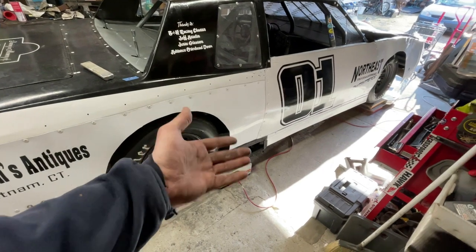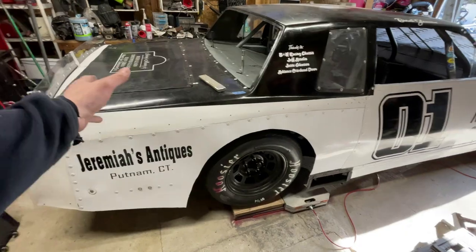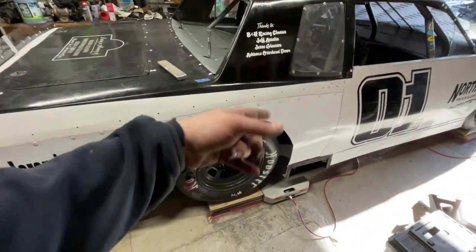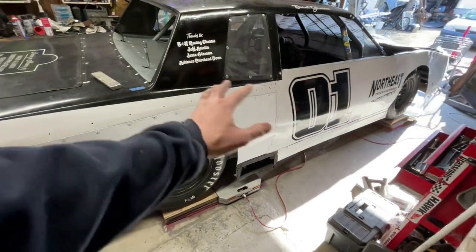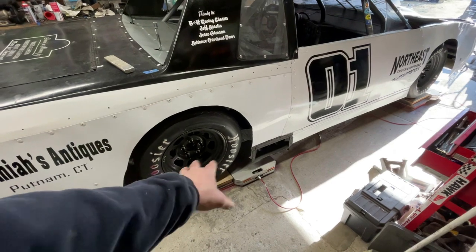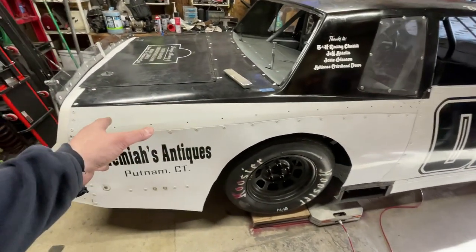So if you're going to race, you've got to spend money — might as well spend it on stuff that works. We made a ton of changes to this car: I had to change the whole rear clip, the spring buckets — nothing is at the correct height. I ran around before setting this up and got some ride heights while it was on flat ground, so now I know at least where I'm starting from. The blocks are the same height and level as the scale pads, so if I need to check ride heights I can roll it forward or backward.